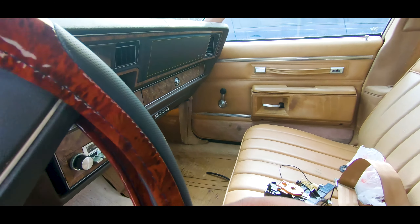So what was going on with mine is — I don't know if you can see it or not, but the more I try to put it as close as I can where you can see, the inside of it was kind of worn out. Basically what it was, the vacuum was escaping — the air was escaping through it. That's why I was hearing that hissing noise every time I put it on vent, and it wasn't working.